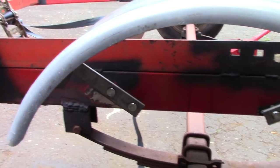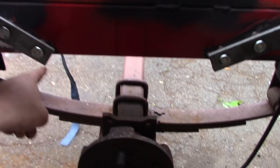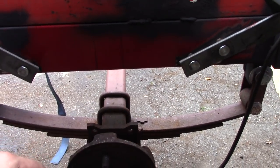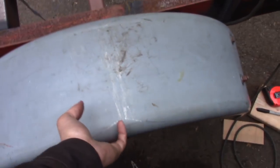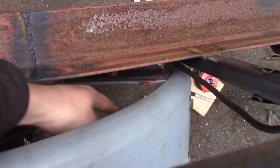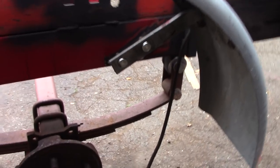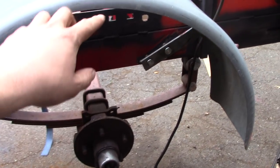I have the suspension on this side all complete and the fender mounted on this side. How I mounted the fender: I found top dead center, measured 12 inches from either side - that's the space between the points on the fender mounting bracket. Like I had mentioned, I took a piece of angle with some stainless steel bolts and put that on there. If I need to shift it from side to side, I can use a ratchet strap to work it in either direction, since the brackets where they mount to the fender are bendable flat stock - maybe 3/8ths inch. Fender is all good; I already checked my clearances with the tire.